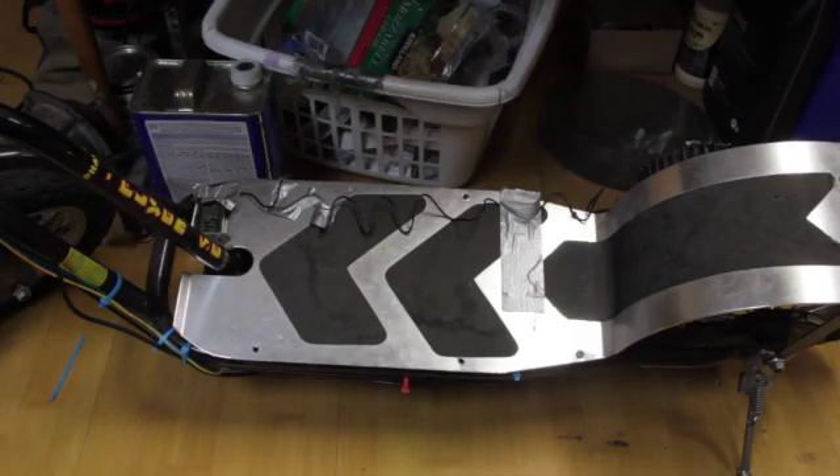We did some testing on the scooter. I'm using it as a test bed to try out different motor combinations, controller combinations, battery packs, and different voltages. This scooter was originally designed to run on a 24 volt battery with a 300 watt brushless controller. I put 36 volts in — the motor is supposed to have a max 30 amp controller. We started at 17.5°C on the motor temperature. Climbing up a hill with about 300 feet of elevation gain, we were hitting about 35 amps, and then when I coasted back down the other side, the motor quit.